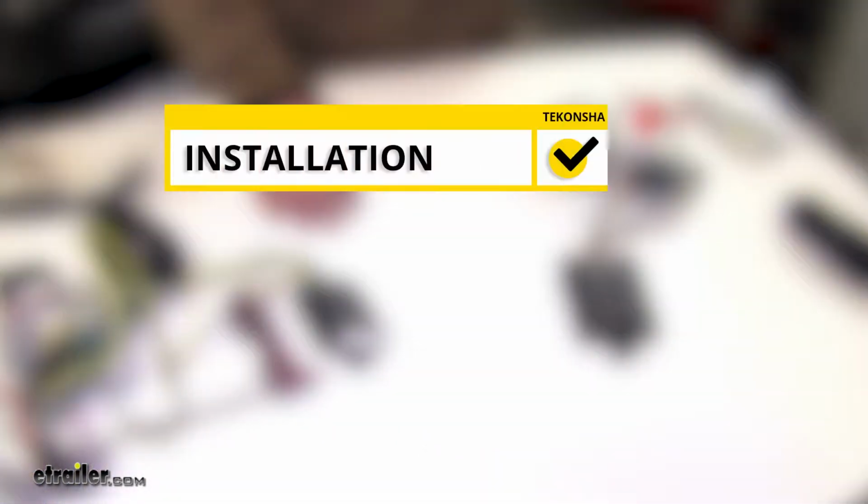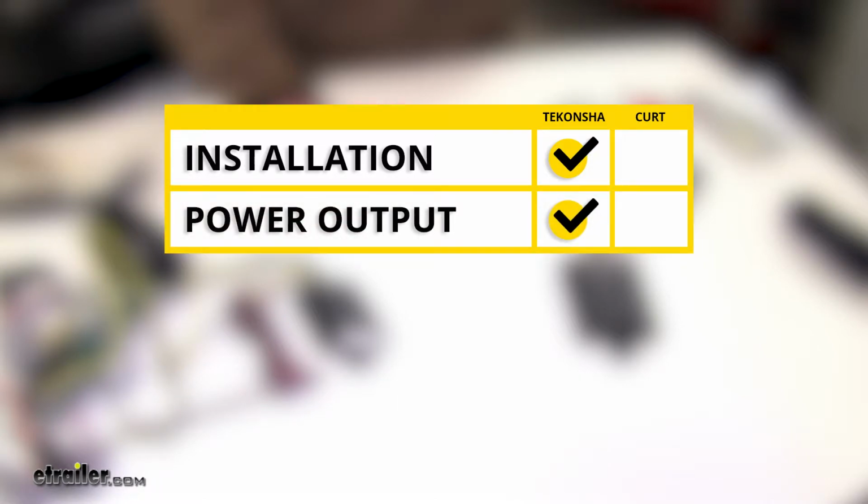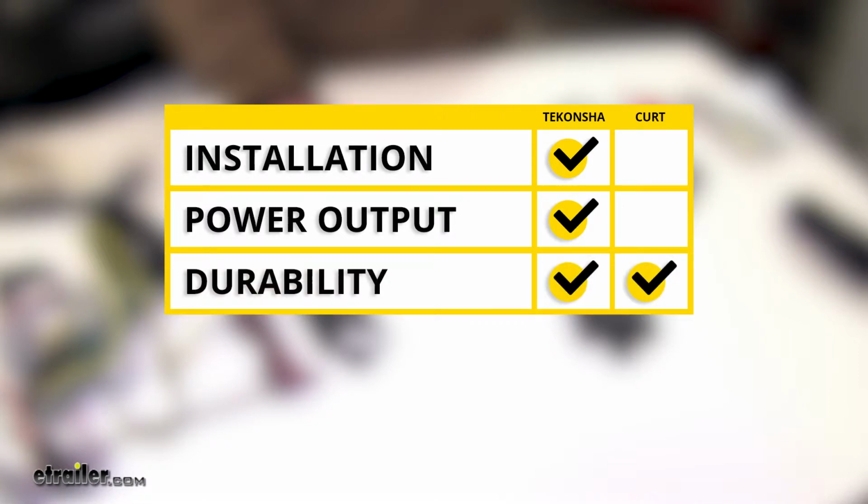Now, in summary, when it comes to installation, we're going to have to give that to the Tekonsha. It's got a smaller box for easier mounting, and it comes with more zip ties and butt connectors to install it easy the first time. When it comes to power output, I'm also going to have to give that to the Tekonsha because it has a higher amperage rating on both the stop, turn, and tail lamps. When it comes to durability, I'm going to have to give that to both. Curt upped their game, and they have potting material in their control box now, and they will also provide circuit protection to protect your vehicle's factory harness.